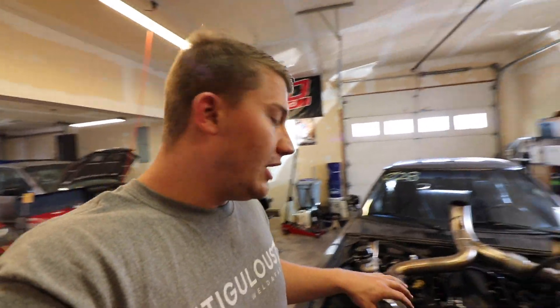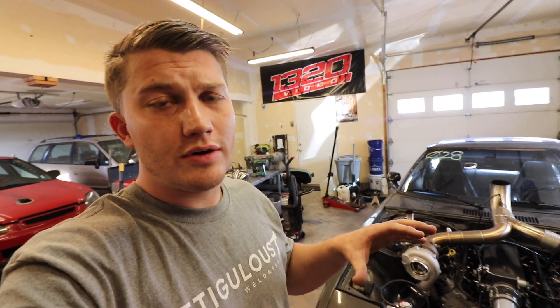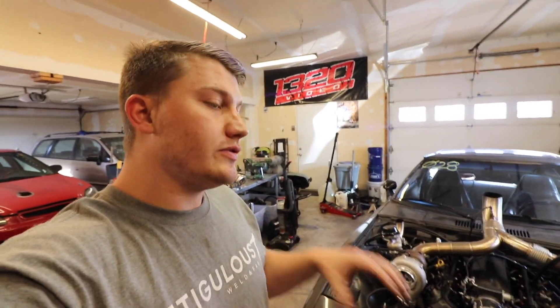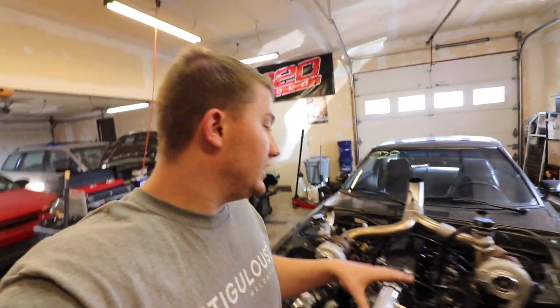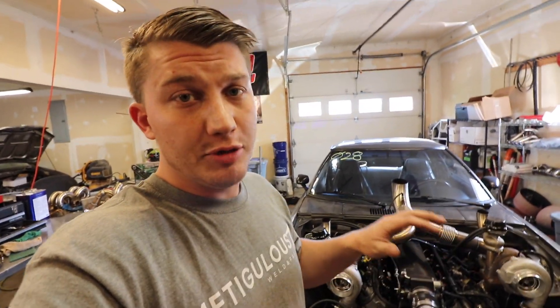I've got a couple other little things to do. I'm going to hook up my steam ports on these heads. I crimped and welded this little steam port shut, but I'm going to route it back into one of the water pump spacers because it has a nice bung for it. That may help with it not getting super hot and help bleed it when I'm cruising. Right now it does have water in it and I have an issue with it boiling water out. My friend Austin and his girlfriend are flying in tomorrow, and my family will be here too.